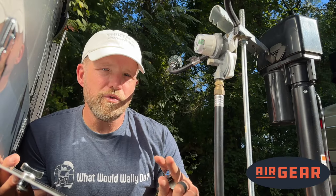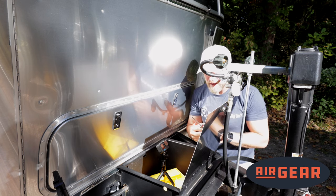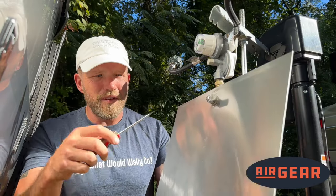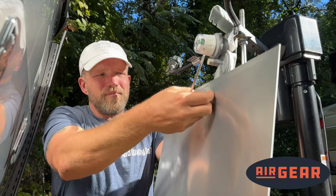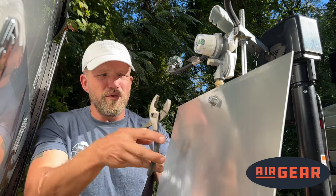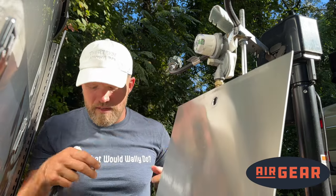You may want to remove your propane tanks and propane tank cover to make this easier to access. Following your instructions, it says remove the acorn nut, but depending on the model you have, it could be a screw — typically this is a Phillips or a flathead screwdriver. Then a basic set of pliers to remove the retaining nut, and then that comes out easily.